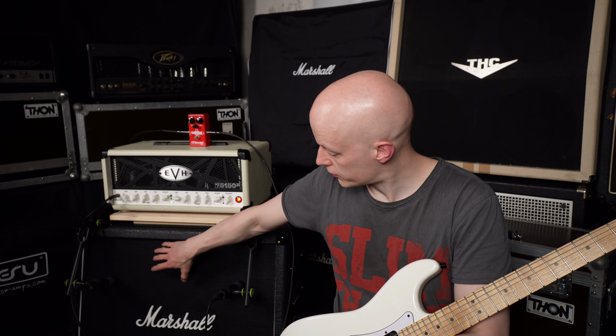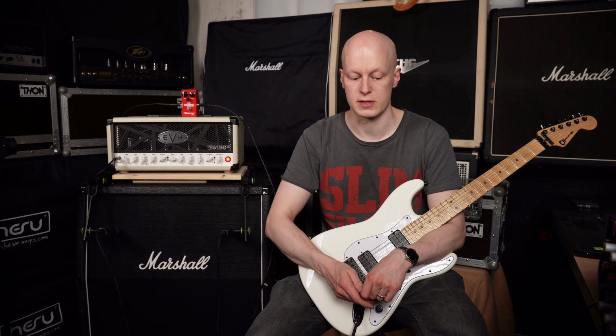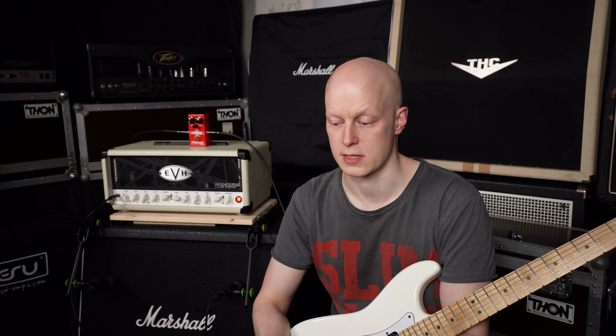Let's get into it. One last thing before we go, I've got the P50E in the Marshall 1960 AV cab next to me here on this side with the Shure SM57. And to my ears, once again, the sweet spot on the P50E is the same relative position as it is on the Vintage 30. So one mic position for this video and one IR for each speaker for you to download and do your own testing at home. Yeah, that's it now.